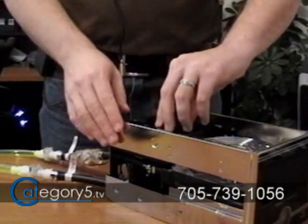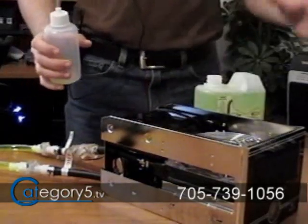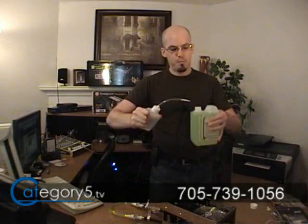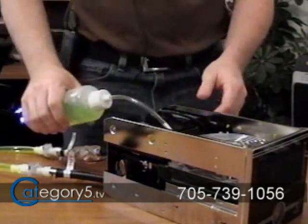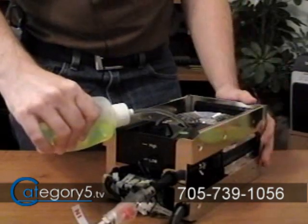The next step in the test is we need to put some liquid in here, so let's open up this device. Grab our handy filly thing — we'll call it George. Grab our liquid coolant. When we want to fill the reservoir, we don't want to start pouring directly from the refill tank because if you spill, that's going to make quite a mess, especially when this is in your computer. So just grab George here, squeeze the air right out of him, pop that hose right in there and release — it'll just start filling through standard suction. Now remember, the first time you fill your liquid cooling system it's going to take longer and you're going to use a lot more fluid because the radiator currently has no liquid in it, so you're not only filling the reservoir tank, you're filling the radiator as well.